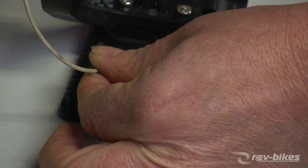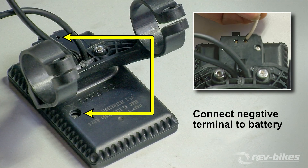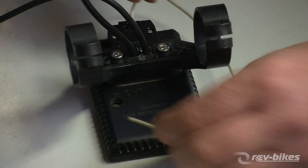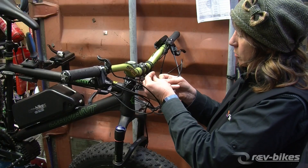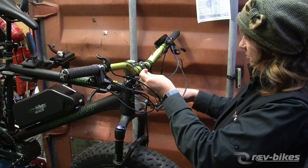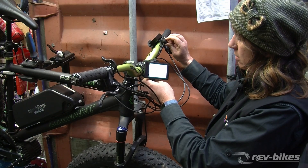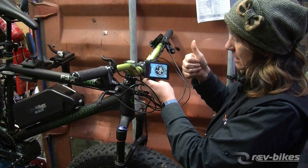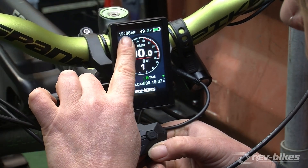We use a small piece of conductive wire, one end touching the battery and the other end touching the negative terminal here, and hold it for five to ten seconds. That should have done the magic — let's have a try. Plug it back in carefully and give it a try. Yes — success!